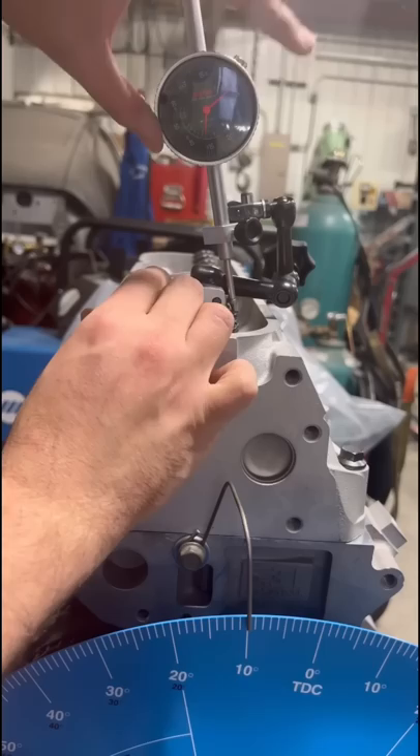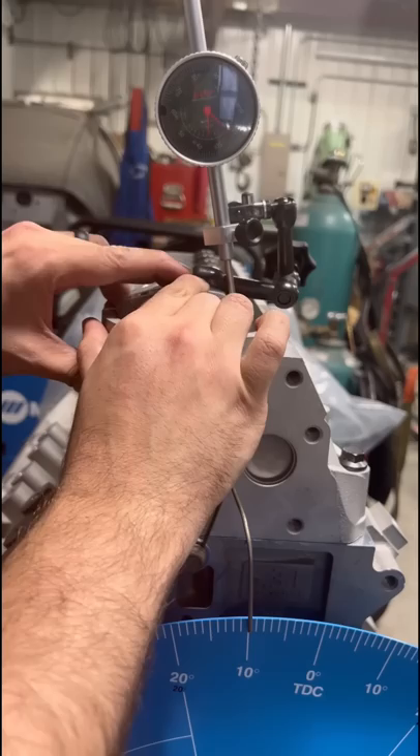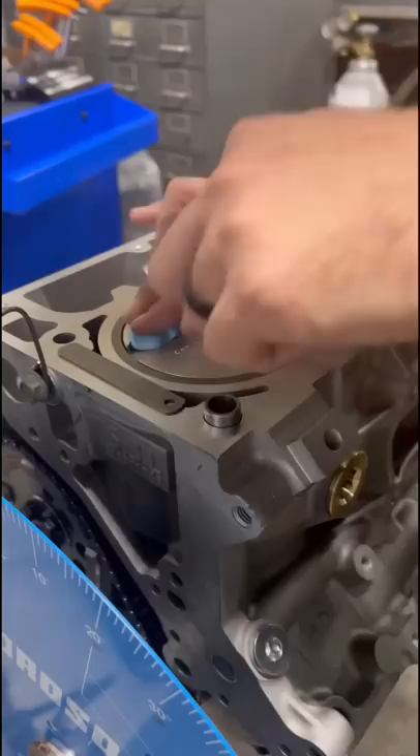In this case, a healthy 275 thousandths. On the intake side, clearance is generally tightest around 10 degrees after top dead center as the intake valve is opening, chasing the piston down the hole. In this case, we have a pretty healthy 257 thousandths.